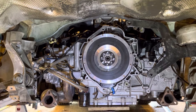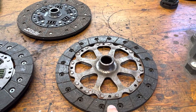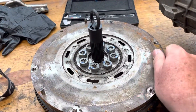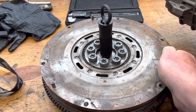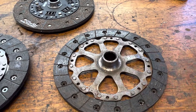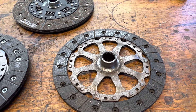The challenge is clutches. This is the original clutch that goes on the vehicle. Because this is a single mass flywheel, the original — which is a dual mass flywheel — will rotate slightly and absorb the rotational variances of the engine. Ours is a single mass; it won't do that. So if we connect the stock clutch, which is rigid, to the rigid aluminum flywheel, you get a lot of vibrations into the engine, more importantly into the transmission — you'll get a lot of gear noise. Not fundamentally a good thing to do.